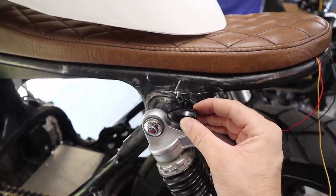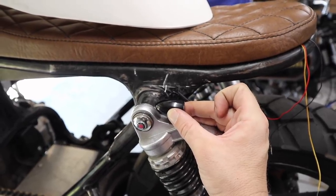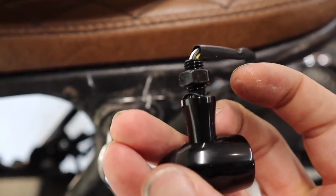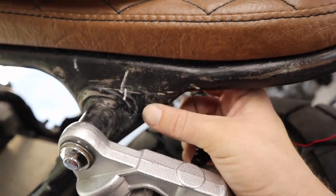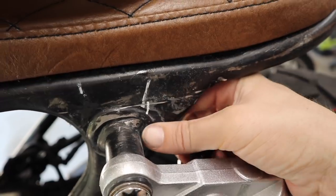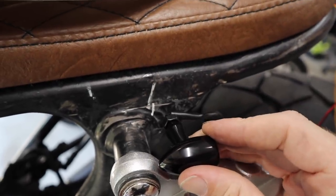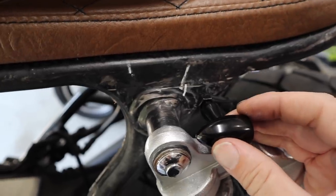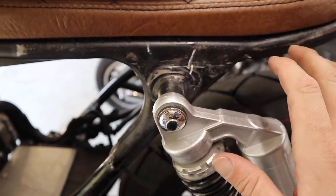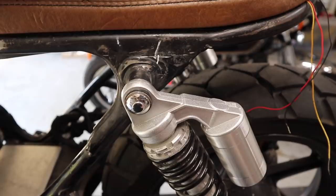I'll do a bit of a mock-up, sit them there, plug them up to a battery and see what they look like in position. The mounting thread is probably only about 15mm, whereas the frame is probably about 22mm, so I'm never going to be able to get that in and put a nut on it. I'll figure out how to bracket it up. It's not crucial to have these on now, but I want to make sure any fabrication and holes are drilled and preset so that when it comes back, I just need to wire everything up rather than drilling holes into brand new powder coating.